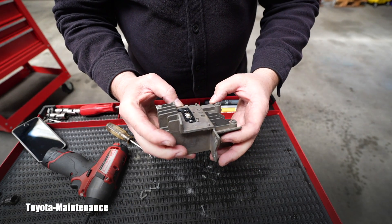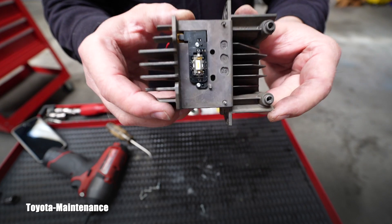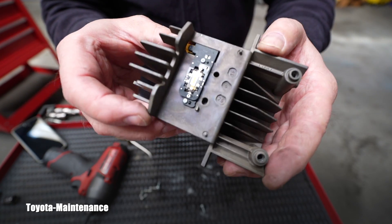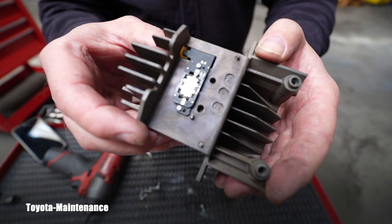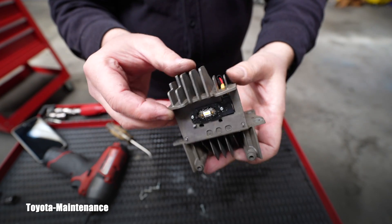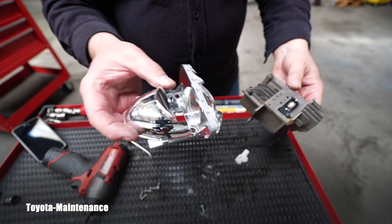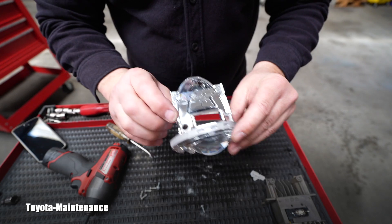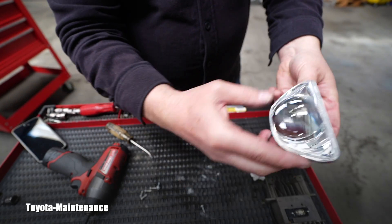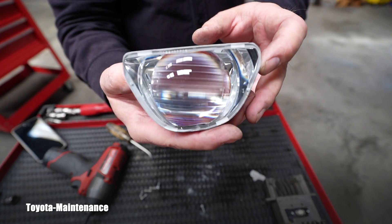I think if I remove these last two Phillips screws we'll see the LED itself. I'll call this the projector lens — oh, it just fell! Look at it — this is the LED itself right there. As usual, it has that yellow emitting area like we know from LED flashlights and LED bulbs. This is the heart of the low beam. It's projected through this shiny element and through this lens — and it's becoming clear, the moisture is gone.